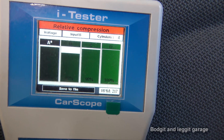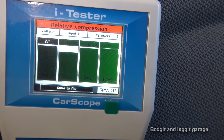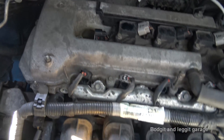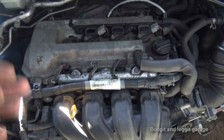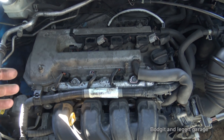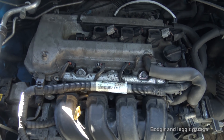Now we've got a 2007 Toyota Corolla 1.4 petrol. I've taken out the number one spark plug and disconnected the injectors. We're not going to sync it this time, but as I mentioned you can sync off the injectors or the coils. This car has coil-on-plugs; the last one had a coil pack. Sometimes you might have HT leads — it's just different connections but the same process.